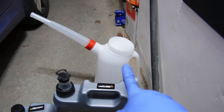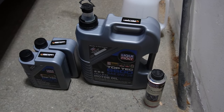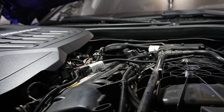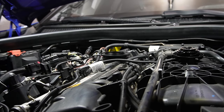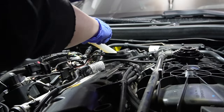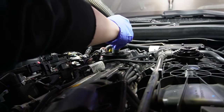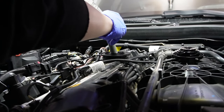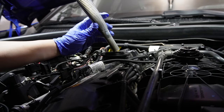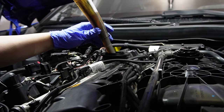I have this style of oil jug where I won't need a funnel — just pour directly into the engine. That's a personal preference. I'll fast-forward through pouring the oil back in. The first pour is pure oil, and the next one will look much darker because of the oil additive — just so you know I'm not pouring dirty oil back in. It's still fresh oil, just darker in color due to the additive.